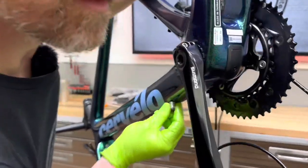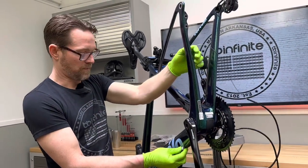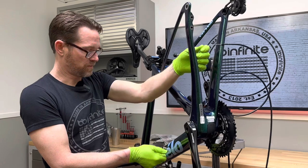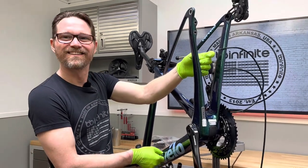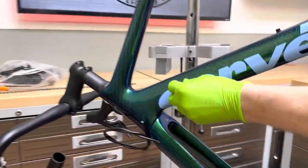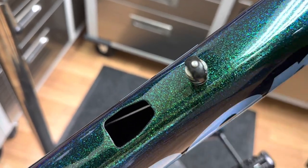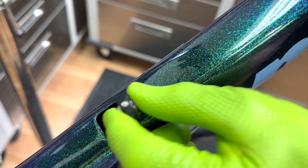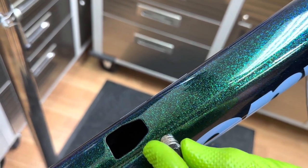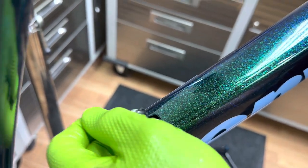Can you hear that? That is the wire dragging on inside of the frame as I feed it in there. I can steer it way up here if I want, for whatever reason. Make sure your magnets are really smooth — you don't want to scratch your new bike. Look at that — it's a ghost. So we're already popping out. Come around here and take a look. I want you to see the jet right there. I can get this thing all the way up to the head tube if I really wanted to. See how I can steer it? And then come right back. There we go.